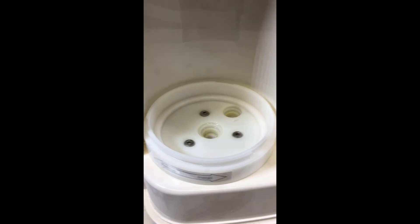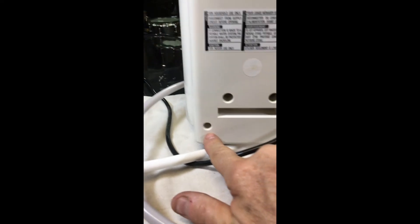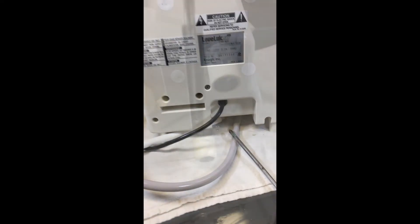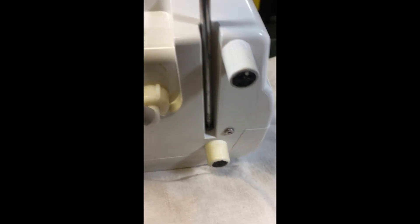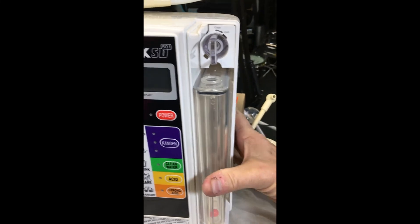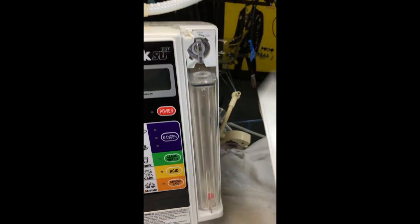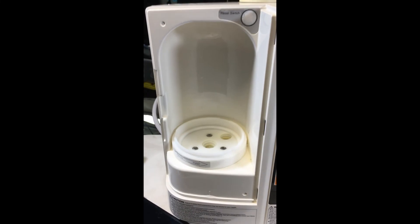On the back we're going to put the four screws in — one in here, one in here, one right there, and one way back there, so you're going to need a really long screwdriver like this one. This is the final screw all the way in with a long screwdriver. Push this back in, push it all the way in and twist. Then put this guy back in like so. Put the cover on, put the filter back in, and the cover back on.